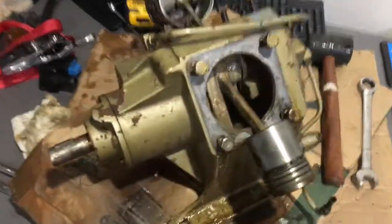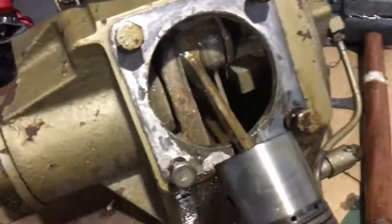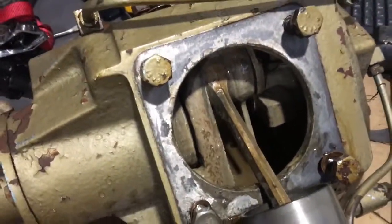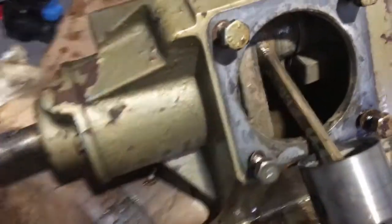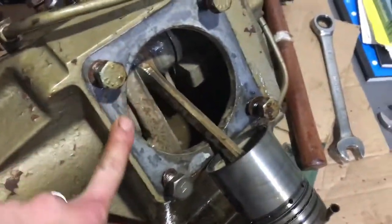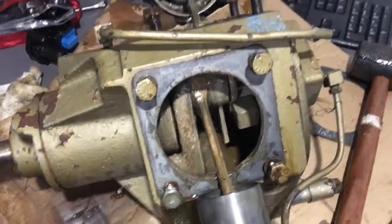The cylinders have been removed and this piston is also in very, very good condition, so I don't think I'll have to change any actual hardware. It's really just gonna be a job where I clean with the wire brush, sandpaper, whatever, and just slap it back together. I'll probably make some gaskets, but depending on the price it might just be cheaper to buy them.